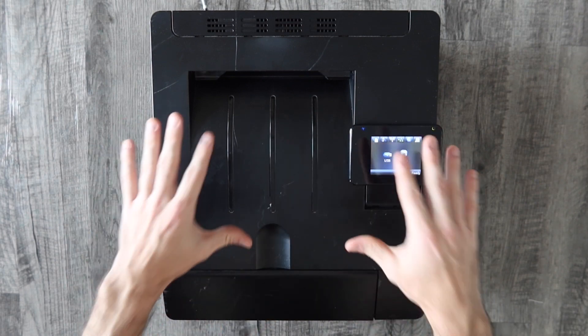It's going to show the previous Wi-Fi network that it's connected to, or it's going to show something like this. I'm going to hit wireless menu and then go to Wi-Fi Protected Setup, then we're going to go to Push Button, and it says press WPS on your wireless router. Press OK to continue.